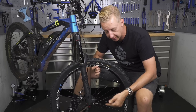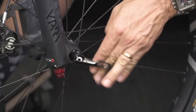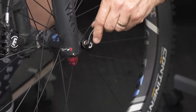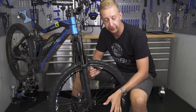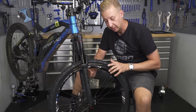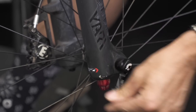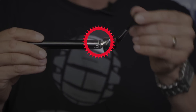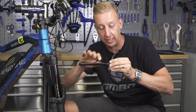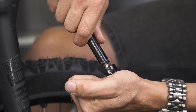For common sense reasons, don't have your axle lever facing forwards when tightened. If you hit overgrown bushes on your travels it could flip it open, which you might not notice, and it could rattle out as you're riding — and that's not going to end well. Like the QR15, you can change the orientation of the lever when it's tight. Unlike the QR15 where you adjust the threaded nut in the fork, on the Maxle system the adjustment is on the axle itself. You remove the axle, and there are markings on it. Push in and locate to change the lever position in relation to the axle.